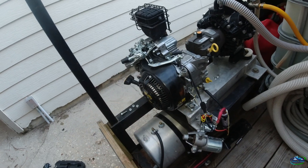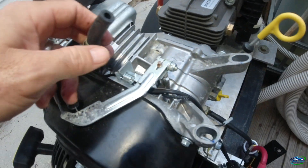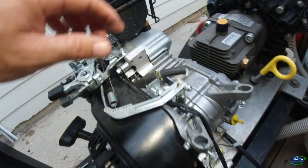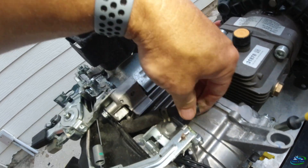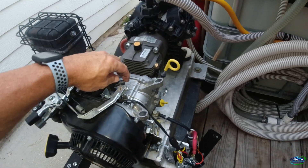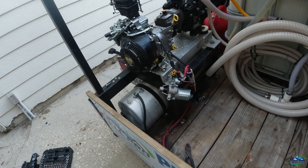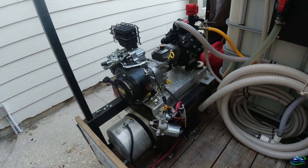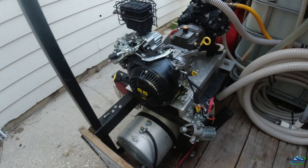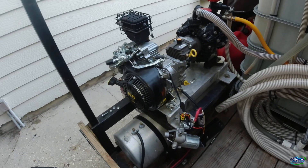This is what it looks like with the fuel tank off. It was just a quick connect here. They got this thing so buried in here — I'd love to get to the carburetor and put a fresh hose on it, but I don't want to take the carb off with the gasket situation and linkage. I may just run a filter in here and one on the other side — double filter, no big deal. I thought about running a longer fuel line to a three-way valve, leaving the fuel tank on in case the fuel pump goes out, but I'm just gonna roll with removing the tank.